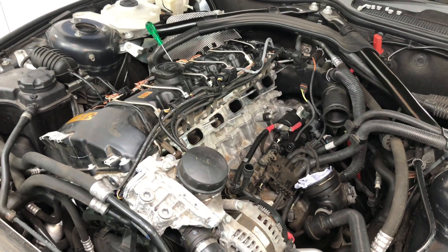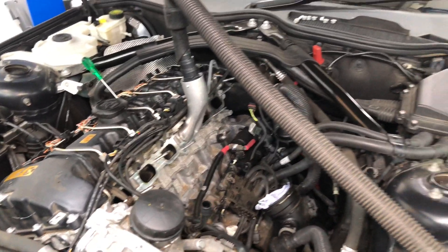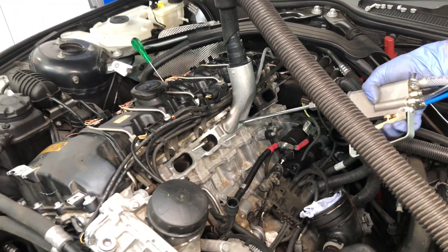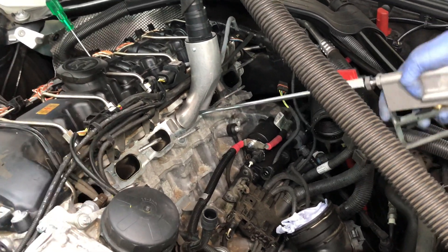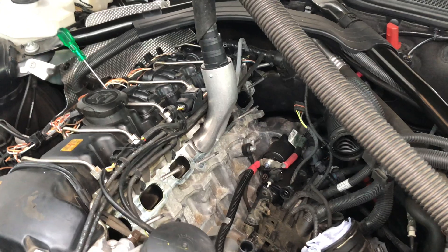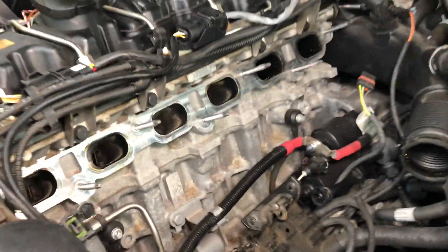This is how quick the process is. Dan's going to install the adapter which has got the shop vacuum attachment on the end — that's a BMW tool, perfect fit. Then the high pressure blasting equipment comes in with the hopper filled up, goes through the middle, you create a vacuum tight seal, and then we send it in for 12 seconds whilst wiggling the tube around and in and out to get all angles. The BMW instruction is 12 seconds. The screwdriver is what we're using to reference TDC — top dead centre — where the piston is up at the top and the valves are closed, done by rotating the crankshaft front bolt.